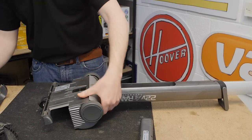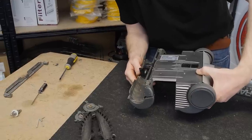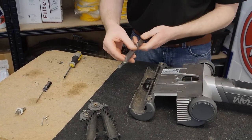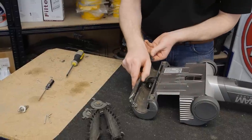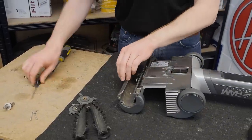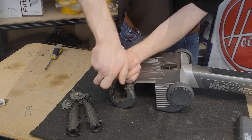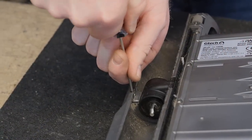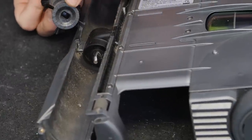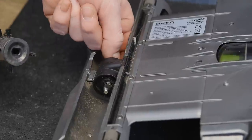To replace the brush head and sole plate assembly, just drop it into position first, then put the top cover over and screw it into place. With the cover in place, you can now replace the brush rolls — make sure that the two flat sides of the fitting match up to the two flat sides on your drive shaft.